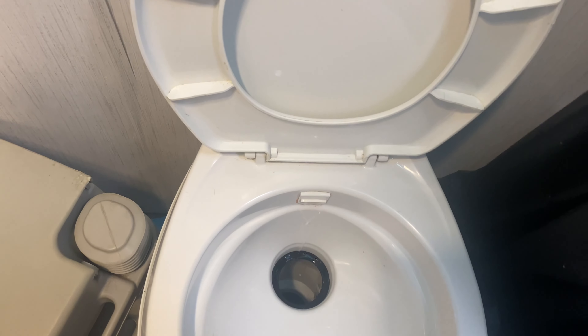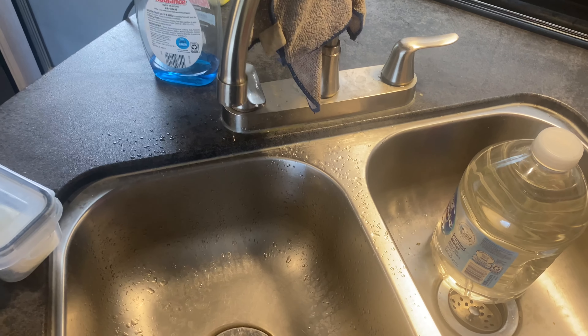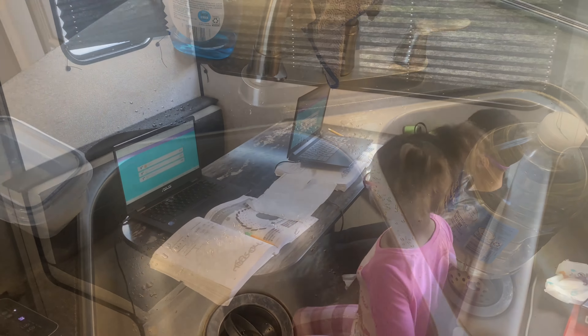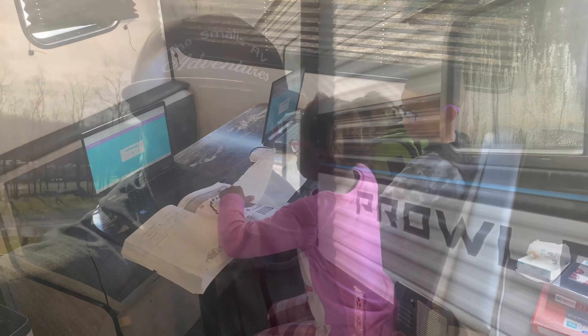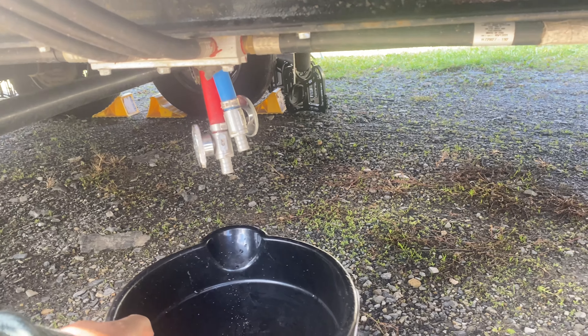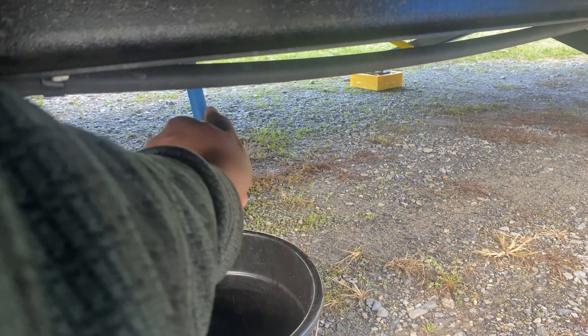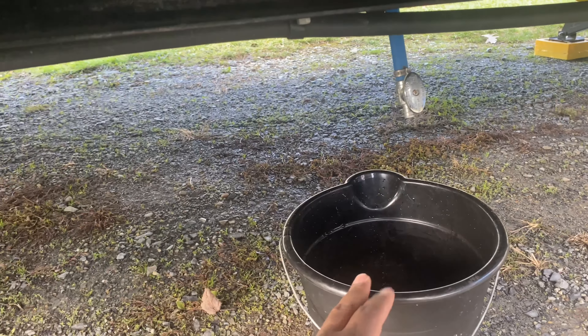Get your RV toilet — it also has water in the lines. Coming back to the sink again. You blow out all the lines, then we're going to open back up the low-point drains and leave those open until we come camping again, and any residual water would just drip out — it should be almost nothing. By the time we leave, temperature is above freezing, so nothing's going to freeze down there. We leave it open until the next time we come camping, which will be in about a week. We do the same thing on the other side — that one has nothing — and we just leave those open until we camp again.